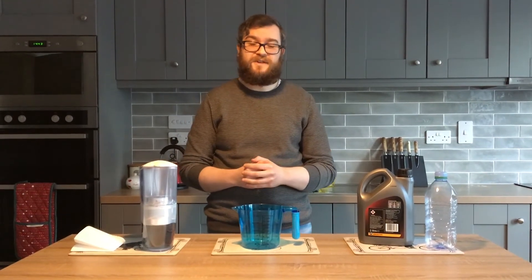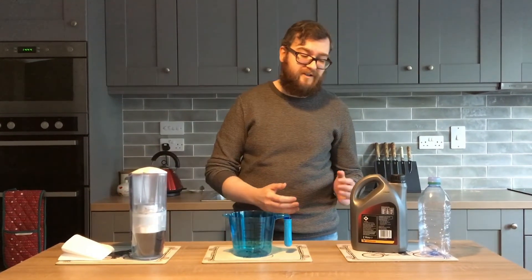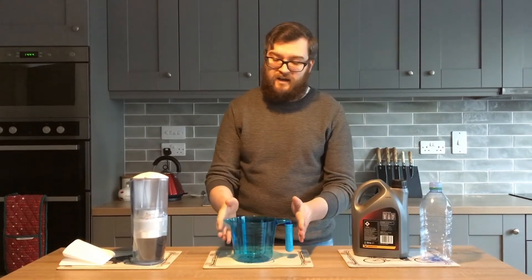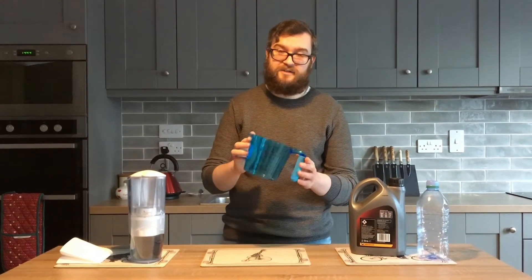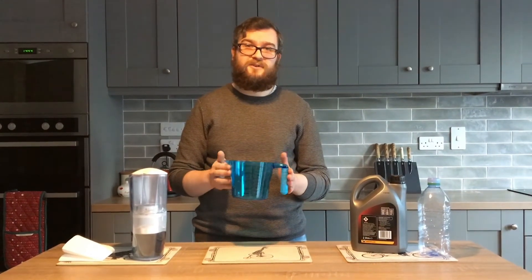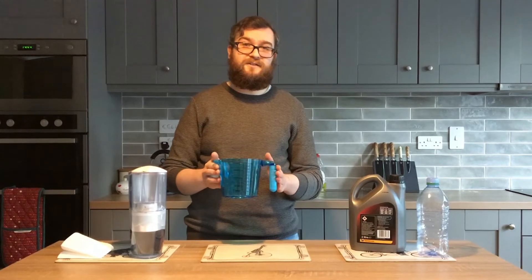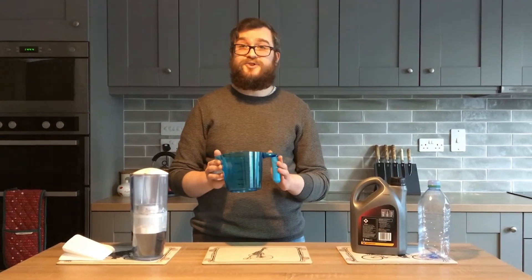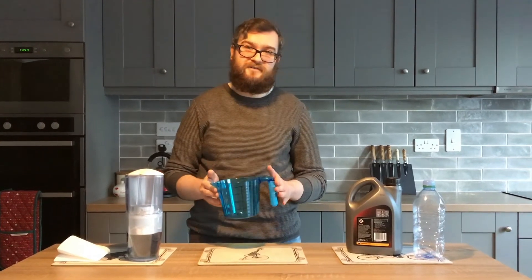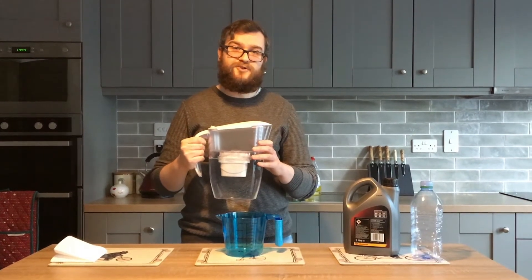It's really around the engine size, but this one is a 1.6 diesel, also known as the HDI. So to do this you'll obviously need your screen wash. I'd like to use a measuring jug — this is a cheap one that cost about €1.50, purely for mixing up fluids related to cars. Some filtered water, because we don't want any limescale blocking up the washer jets and nozzles.